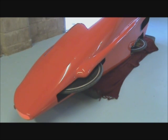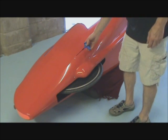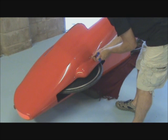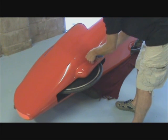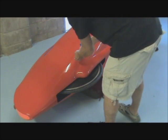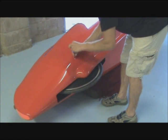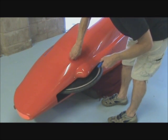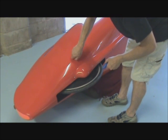Just by the rear tire of the Quest is a small compartment that you can open up to access the rear derailleur. This is important when you're doing a bottom bracket adjustment so you can keep your eye on the chain length to make sure you're staying within the limits of the derailleur's capabilities. I'm going to take a 3mm hex wrench — there are 3 hex bolts that hold this compartment in place — and I'm just going to loosen those off and remove the cover.